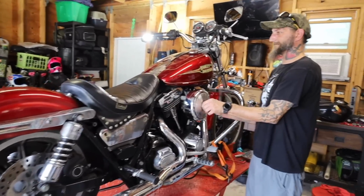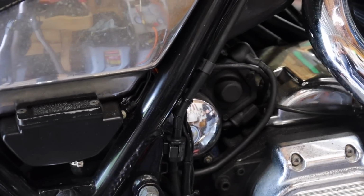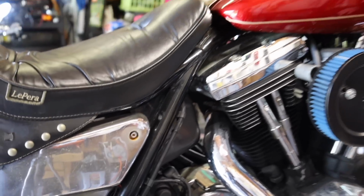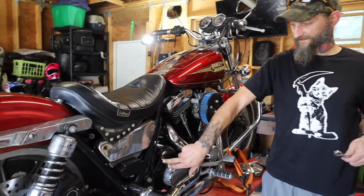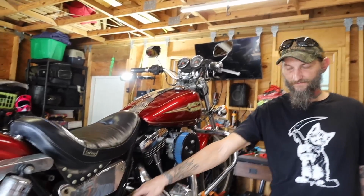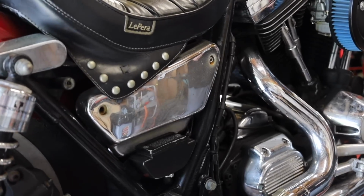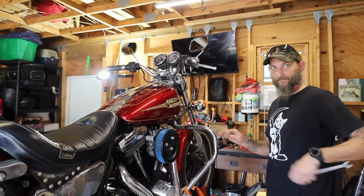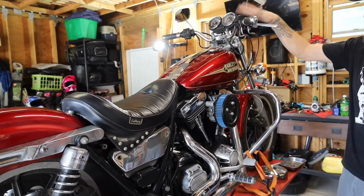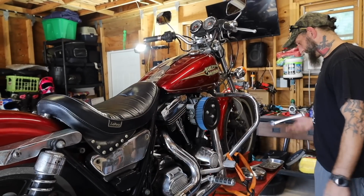One thing I do think we'll do, and I'll go ahead and order one just to avoid that situation I just talked about, is put a push button starter on these things and then completely avoid a low battery causing an issue. Right there, it's a solenoid cap with a button. That's all it is. You see them on bikes all the time. If you've ever seen a guy on an older bike lean down and push something down there, that's the reason that's on there. I think that's a mod anybody could agree with. That eliminates this guy, all this wiring, and it's a lot beefier switch. But that's a job for another day.